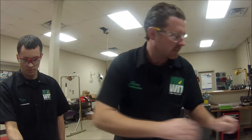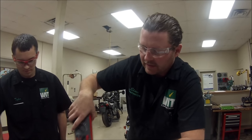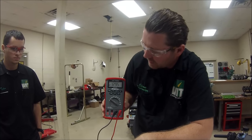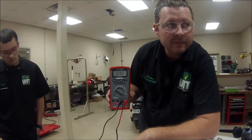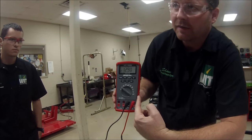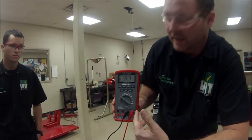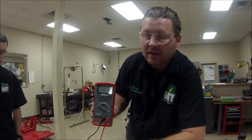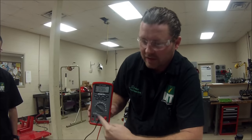Now we're going to check the charging system. Notice how just for running for a couple of seconds, the battery voltage jumped up — we saw 12.9, actually 13 volts. In just a couple of seconds of running, this thing jumped up to 13 volts from that 12.5. That's just surface voltage that the charging system pumped in there.